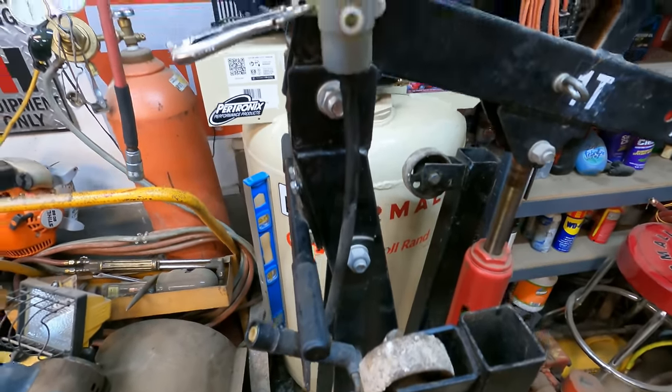But anyway, I guess we'll go ahead and switch on the vacuum pump here. I have this little temporary reservoir rigged up here with brake fluid in it, and that runs down to the bleeder. And the bleeder is cracked open, and then, of course, we have fluid in our reservoir still. Hopefully I should be able to just plug this bad boy in and it'll suck that fluid down through and up through the system here. I just got to make sure that doesn't run dry, and then we'll be screwed again.